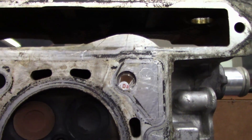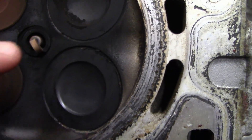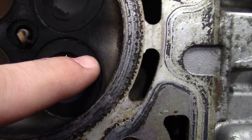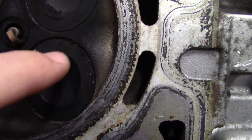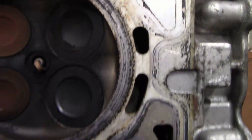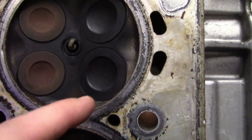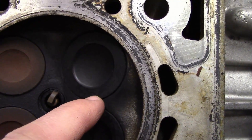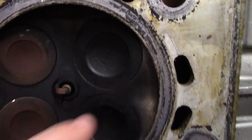This side is the intake valves. If you look around the edge, you can actually see this flaking off here — this is where the edge of the valve is actually worn, and that's why these don't seal correctly anymore. This one had low compression in all four of the cylinders. As you can see, there's wear right here, a little bit of wear right there, and you can see this chipping and flaking off here.